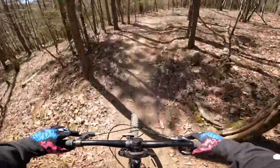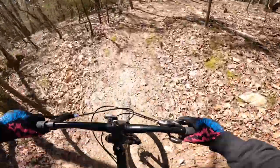Could use a little more tooth count on the rear cogs back there. Remember, this is a freewheel, not a freehub. 8-speed. Could use some more gearing. But I mean, it's not terrible. It's decently comfortable. Man, if we had a lockout on that fork, that would be a big plus. But we're talking about it being interesting, us getting a small as opposed to a medium. This thing's reach isn't bad at all for me. It kind of feels like the cockpit's just the right size. Man, that front fork, that SunTour, is hurting. It's just bouncing all over the place. And we got the stiffest preload on it right now.